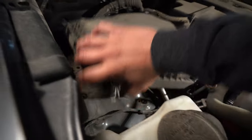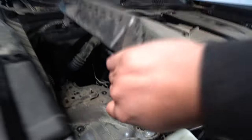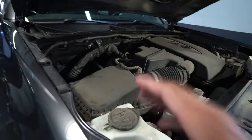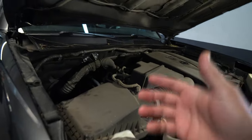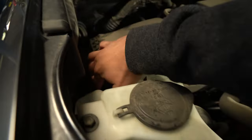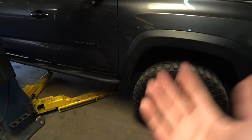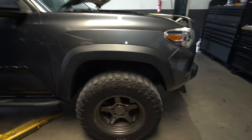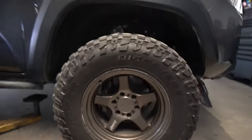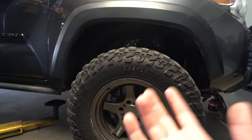As you guys just saw, we had to take out the intake filter and the intake box, which was down there with just a couple bolts. Once again, if you want to watch our in-depth install video it'll be in the description box below. You could also just hit up Jerry to do this for you. First step: take out that intake box. Up next, we're going to be lifting up the truck. Get a jack and lift the truck — we're going to have to go underneath to make our life easier. We'll be removing the wheel and then removing the wheel well underneath.